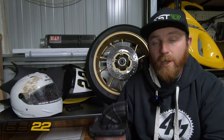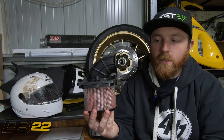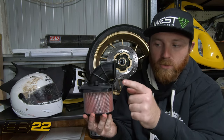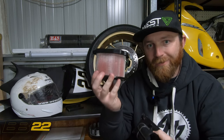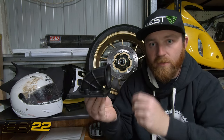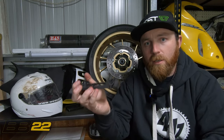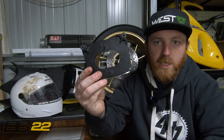All these results are a bit more horsepower than some of our previous testing. The way we did the testing was: we ran stock, made a change, got the result, then changed everything back to stock to make sure our results don't drift. We have the stock snorkel in the stock airbox lid, which you can see here, and the OEM air filter. The big debate is what happens if you remove this snorkel — or is it best to leave the stock lid on.